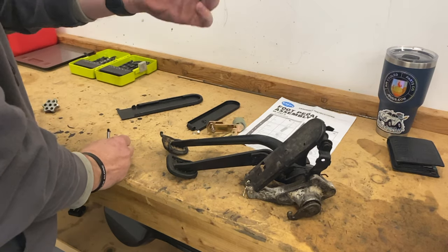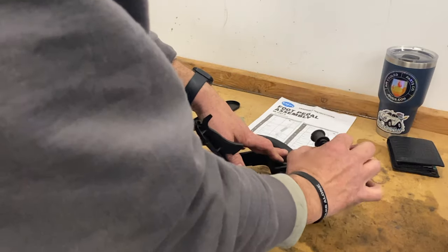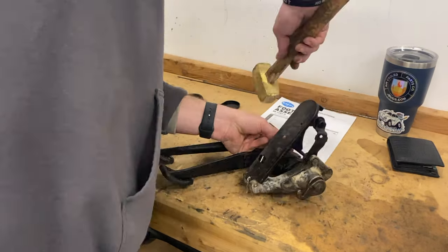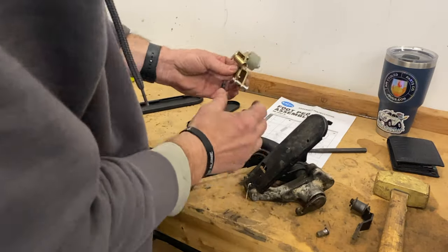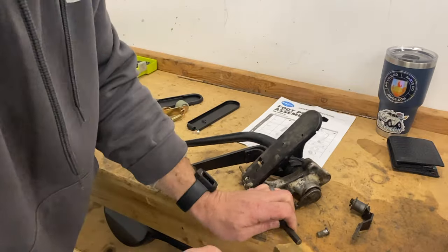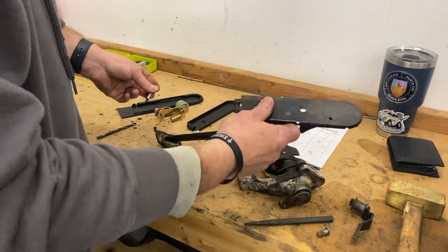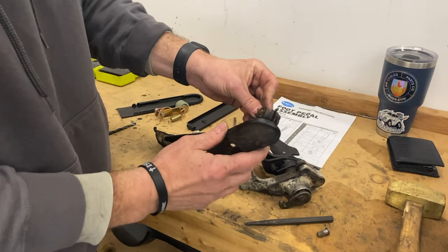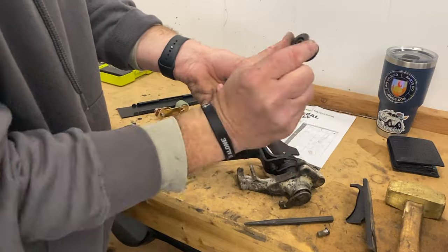Six and a half millimeters — basically equivalent to a quarter inch. We've got our pedal assembly on the bench. We'll pound out that pin. Here we can see the stock accelerator lever — it's only got one pivot point. This upgrade will double up that pivot to give it more stability. The stock lever gets upgraded with a double-pivoting lever, much more secure on its axis. We need to push out this pin; you can see that the upgraded shoulder bolt doesn't fit our stock pedal, and our stock pedal has this ramp that's even off-axis.